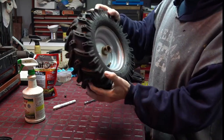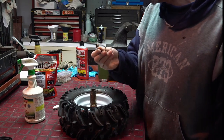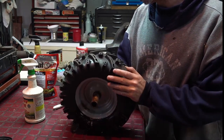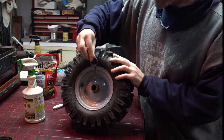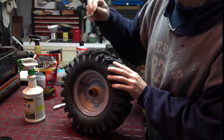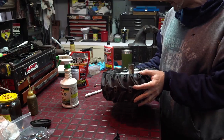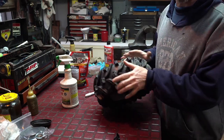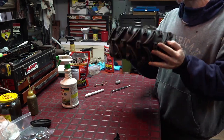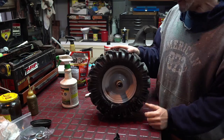What I'll do is go — this tire comes off real easy. I set up with the one with this pin on it rather than the bolt on the other end, because this is designed to disengage so you can move the wheel on a snowblower back and forth — either put the clip on the outside so the tire can free-wheel for easy turning, or put it on the inside through the hole on the rim to engage the tire full time and have positive rear drive. So I'm going to wheel this over out of my way, pull the tire off or spin it around every now and then, and leave it upright so I can play around with it and make sure I'm getting sealant over the area I know is a problem. I think it's done.